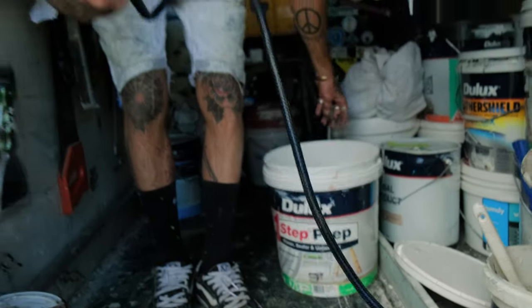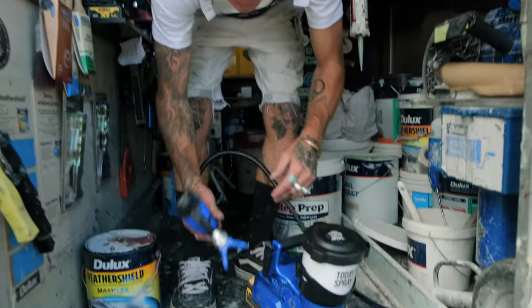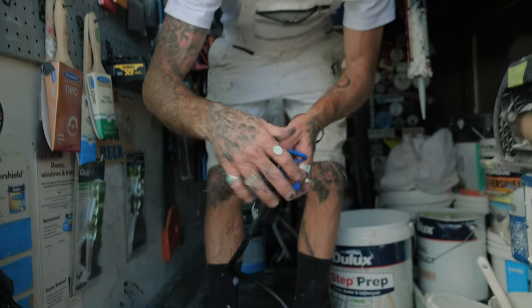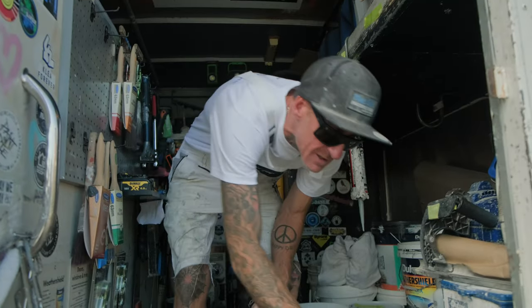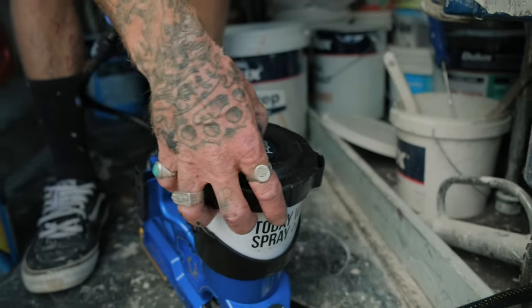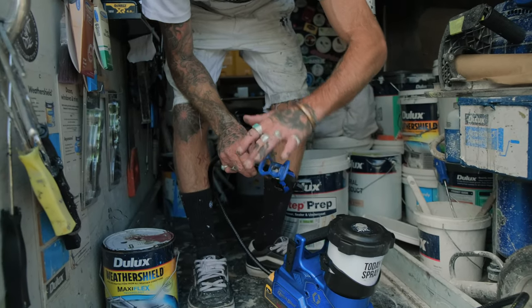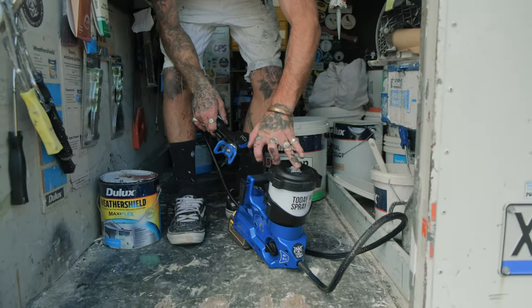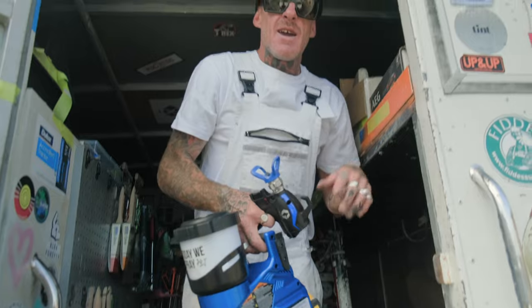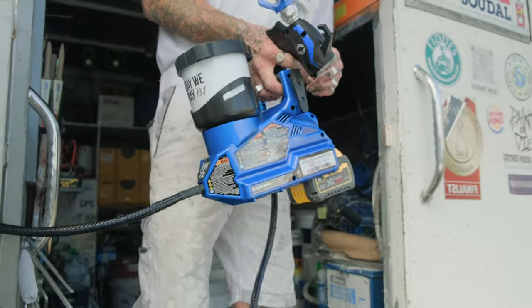This is just our undercoat, so it doesn't really matter that it's going to be a bit of a different shade. I can put the tip in reverse — it keeps it airtight on this end. We've put the cap on here, so it's really sealed up. No air is going through into the gun, no air going into the cup to dry out the paint. We can bring this inside, sit it down, sand everything, then go straight into spraying.